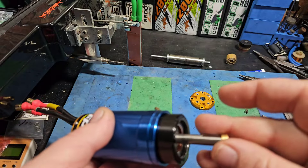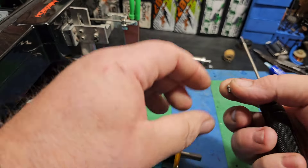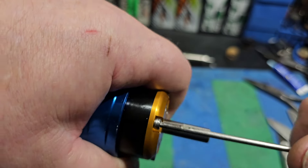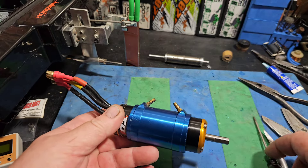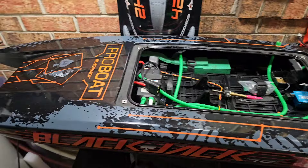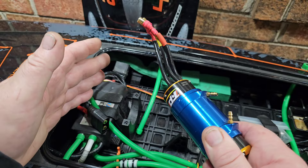The rotor could be good and the ESC might be bad — we're gonna see. One of these days we're actually going to put the Hydra on this 1400 KV CM motor and test the difference between the 400-amp Flier and the Hydra. The Hydra doesn't run 12s, so running this motor on the Hydra on 8s versus the Flier 400 on 8s we're going to pull a lot more amps than we pull on 12s.